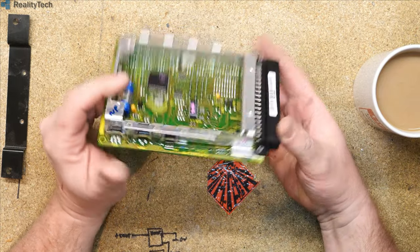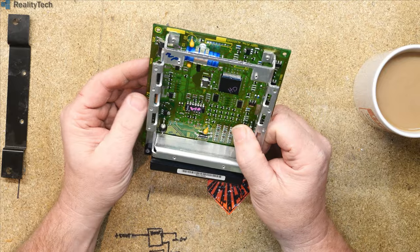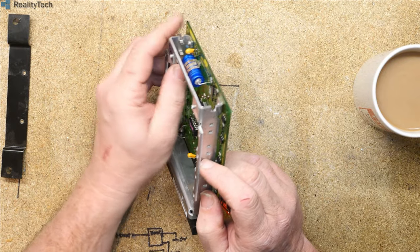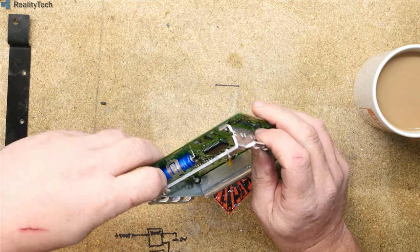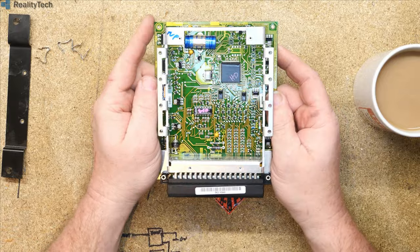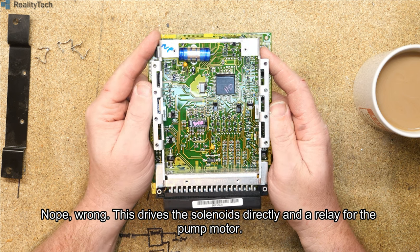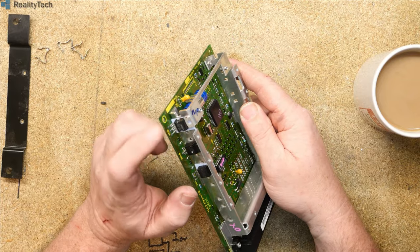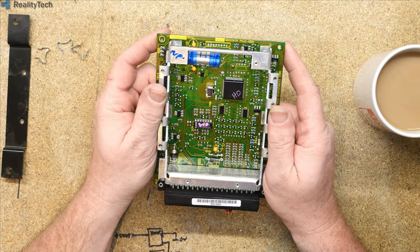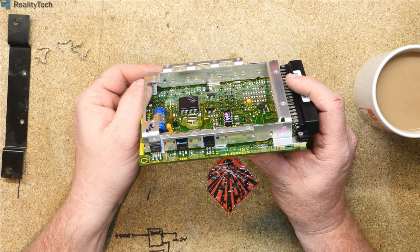What's actually in here? Well, to be fair, that's a lot of box and a lot of PCB for something that could be a lot smaller. Let's pop these clips off and see what devices we've got on the end here. I'm guessing one of these is going to be a regulator. We should in theory have a driver for possibly the pump. There is a driver module that goes with this in the valve body that converts the low-level outputs of this to high-level outputs for the solenoids and possibly the pump. It looks like we might have something here that can drive the pump. If you've got issues with a particular solenoid not working and the solenoid is good, then it's the driver board you want to go after first.